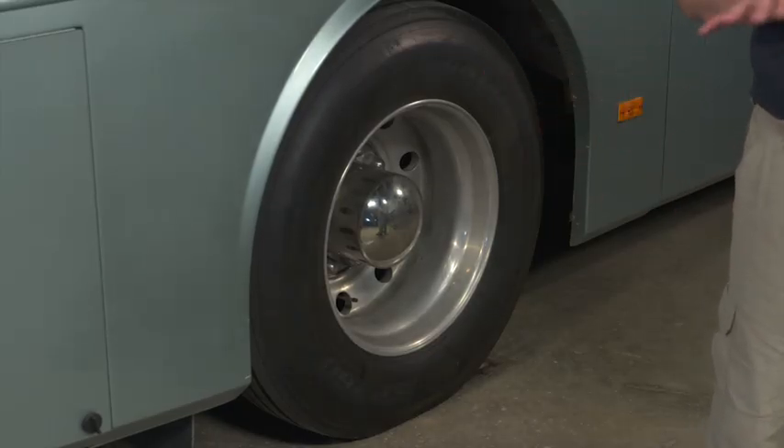The next thing is GAWR, which is gross axle weight rating. Do I have too much weight on the front end? Do I have too much weight on the back end? The heavier the vehicle, the more it's going to move around, the more the tires are going to be a little mushy going down the road. Go to a CAT scale — you'll find them at just about every Flying J or Pilot. If you go to CATscale.com, you'll see one in your area. For $10, put it on that scale, put the front wheels on the front pad, the back wheels on the second pad. That way I know gross vehicle weight rating overall, and I also know that I'm not over on one component.